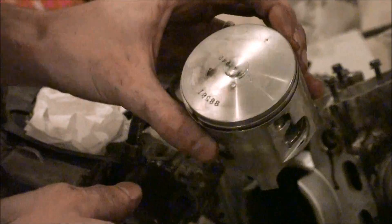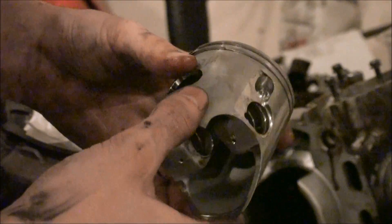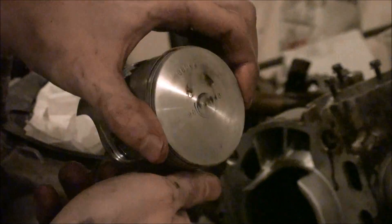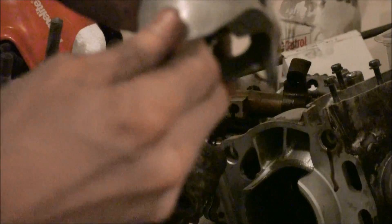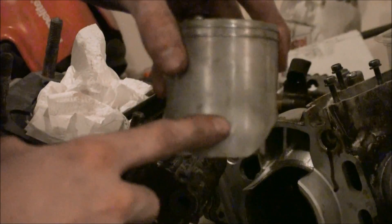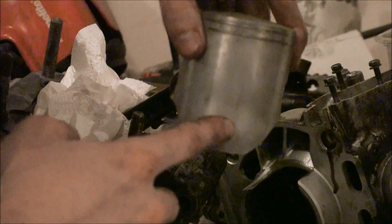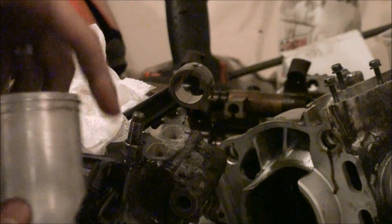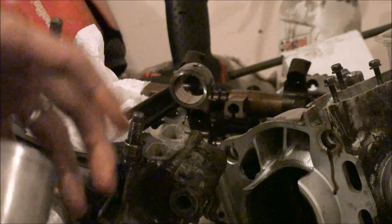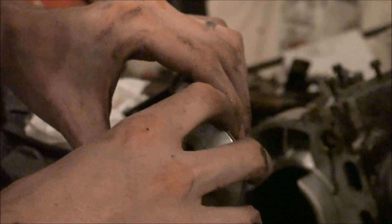Here's the piston — still clean as can be. The piston has a special coating to stop carbon from sticking; some sort of ceramic coating, I believe. What I was worried about is hairline fractures on the exhaust side of the piston, because that's the side that takes the load. Last time one of these fractures shattered the piston into a thousand bits, went down into the crankcase, bent the connecting rod, and made a real big mess. So I'm going to replace the piston just to be safe.